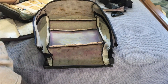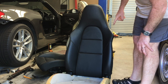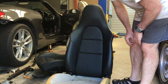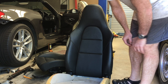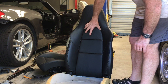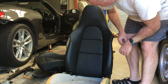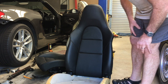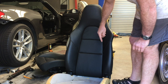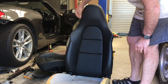Here is the passenger seat which had the most damage. I've fully sewn a new center panel, replaced that panel, that panel, and the one that runs over the top — just using faux leather, which is not even close to the quality of the original leather, but I just wanted to practice and make it look not as terrible as before, and it's turned out okay. Like I said, this shape at the top is really critical to get right; that took the most work, even though I thought the center one was going to be the simplest.